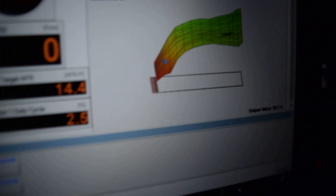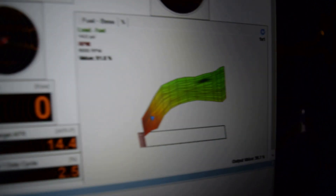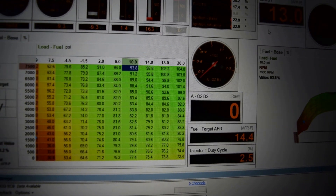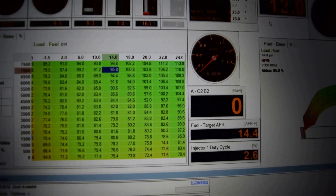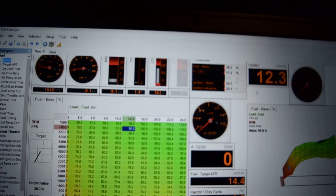Quick update — TJ's working on the throttle position. The throttle cable may need a little tweaking. We are still working on the fuel map and we've got it up to about 14 pounds. We have a pretty linear increase on our fuel. We're going back through making sure we're not leaning it out too much — we're not on a dyno, so we want to make sure we have conservative fuel on these road pulls, not running it too lean. So we're making little adjustments as we get to 10-12 pounds, and then we're good. Round two — I think it's that throttle screw for sure.